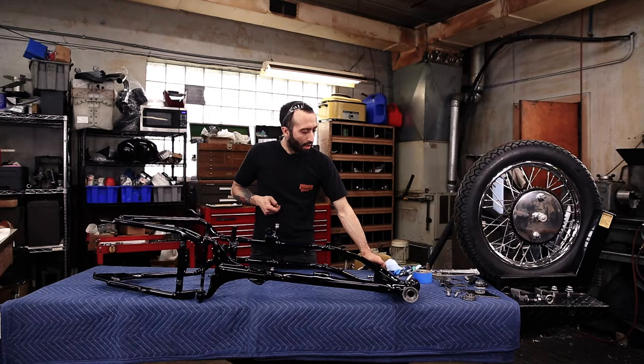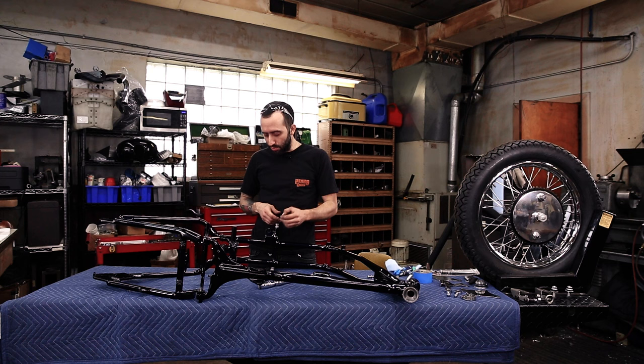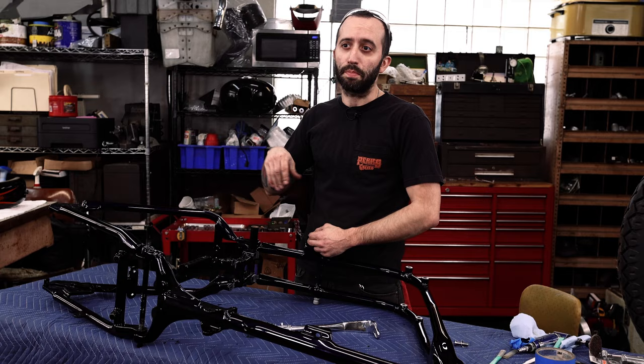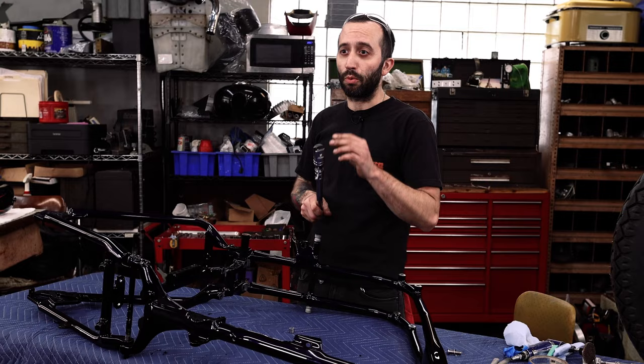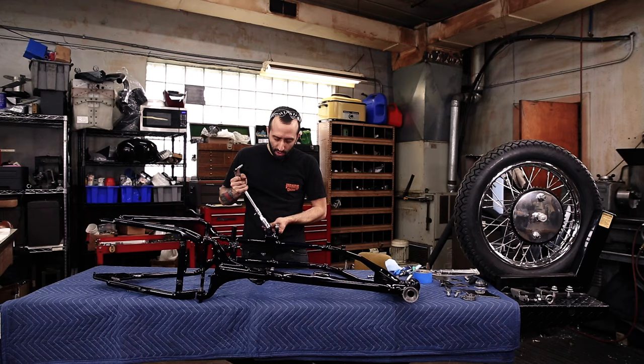Okay. We're also gonna need to clean off the spot where the kickstand goes. We got a couple issues we have to deal with. So first we have a spacer that slips down in this hole and that isn't going in the hole. So we're probably gonna need to drill that out, or maybe just when we clean the paint off the flat surfaces, we can chip it out of the internal hole. Cause also this snaps around the boss of this kickstand mount and the paint is so thick that it's not allowing it to go on. So we're gonna have to clean off some paint.